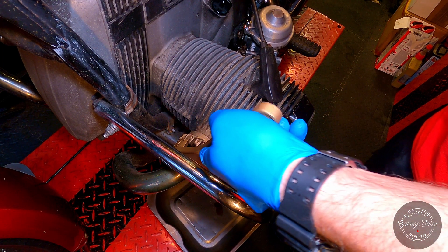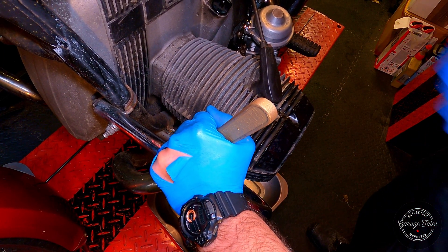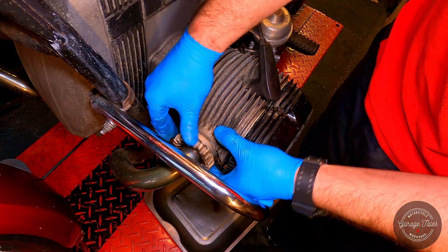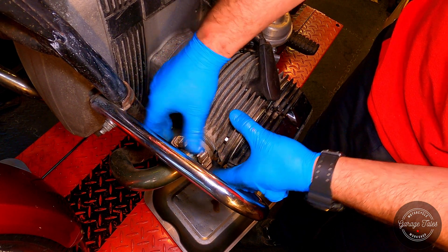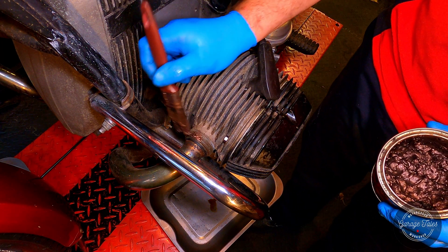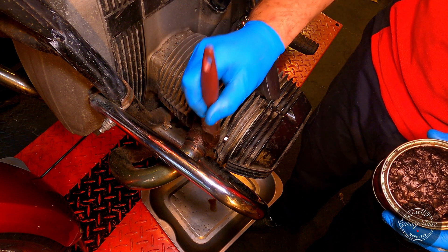Now I'm undoing the nut on the other side, which fortunately came loose after a few taps as well. You may be able to notice this one is slightly more corroded and the edges aren't as sharp, so they didn't come in the same set. So clean the threads again, apply a thin coat of copper anti-seize, put the nut back and give it a few taps to tighten it. And that's it, we're done with this video.